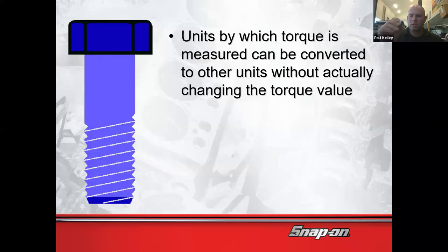So part of the reason that I bought these bolts, I was working on a drive shaft. And when I went to take the drive shaft bolts out, I could not move them. They would not move. By the time I got them out, I had mangled them. And I'm pretty confident that the last person who worked on it just severely over-torqued those to the point where, basically, the head of this bolt can only withstand so much torque. There was so much friction and torque applied to these threads. The bolt, even with a nice, good quality Snap-on or something socket, it was trying to strip the bolt out. So over-torquing it can come with some negatives. And it doesn't just affect the next person to take it out. It can affect it right there on the spot. As you'll see, we'll get a little bit further into here.